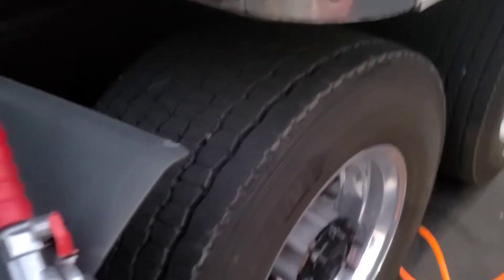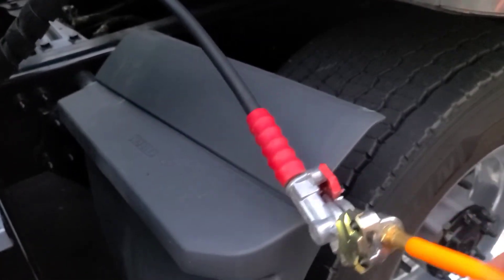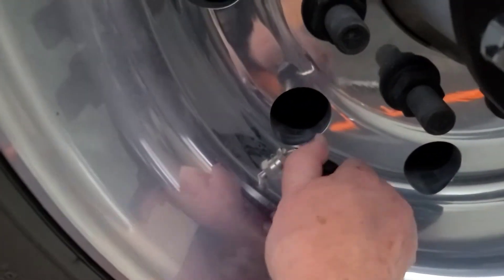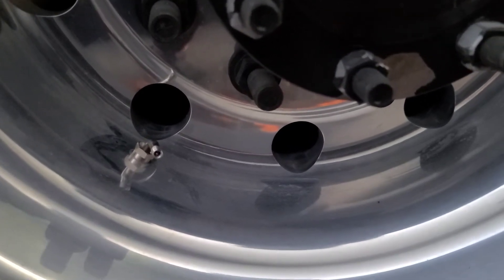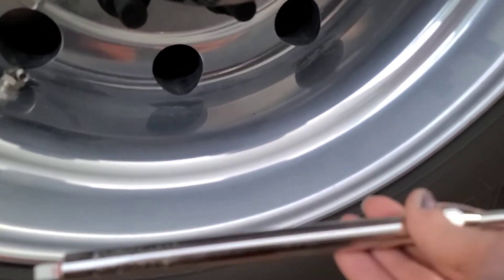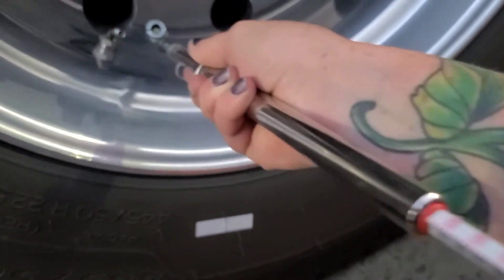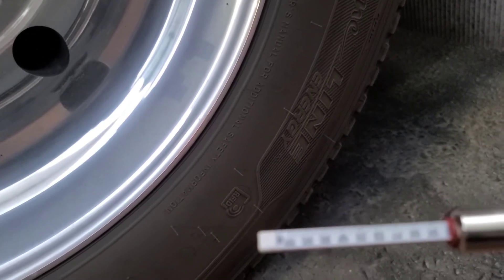What you do is — I've already attached it — you take and attach the end of the hose to your red glad hand that supplies the air pressure to the trailer. Then we go on over here and this tire is one that's been giving me grief, so I'm going to take off the valve stem cover. This right here is the tire pressure gauge — it's a longer one, not the normal car one. It has to be a big one for commercial vehicles or RVs. Take that and stick it on the end here to check my pressure. We're at about 98, so not too terribly bad.